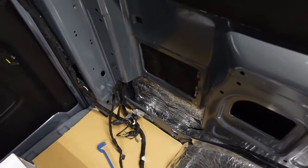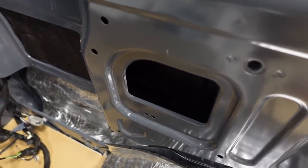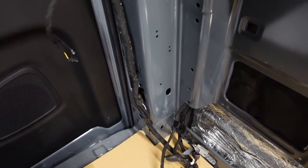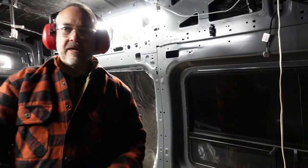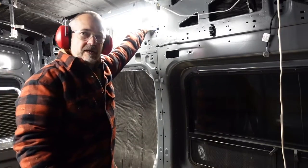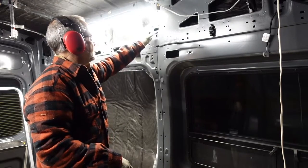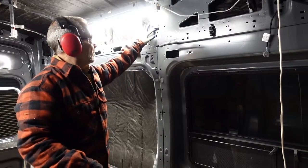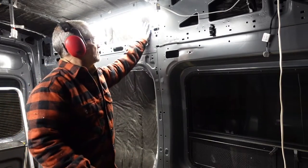On the driver's side I have to undo the ground straps and there are a couple of connectors - one that comes across the top connecting forward, though there isn't one on my van. Take off the tail light on this side through that opening and pull it out through the top. Now with ear and eye protection on, I'm going to cut a section here. There's a bulkhead that blocks the wiring harness from coming through, so I'm going to cut a little groove in it. I was going to drill a hole with a hole saw or step bit, but some of these connectors are pretty big.